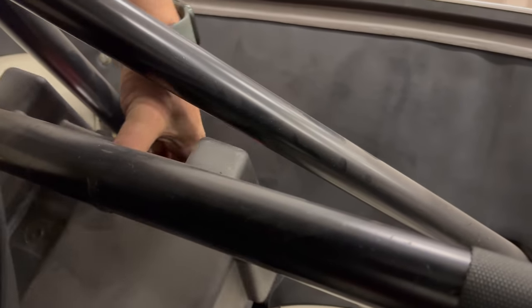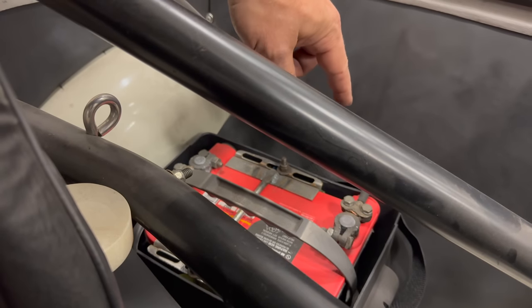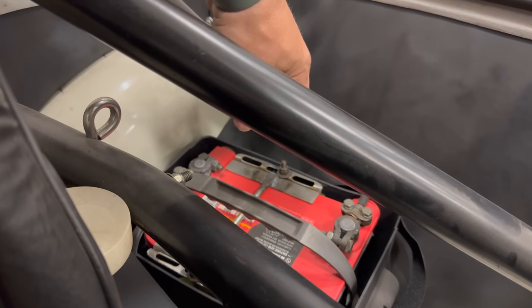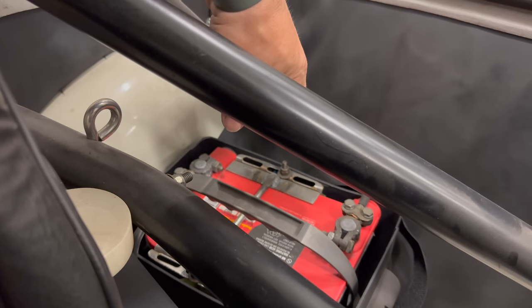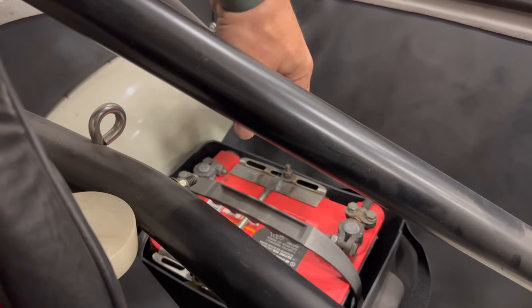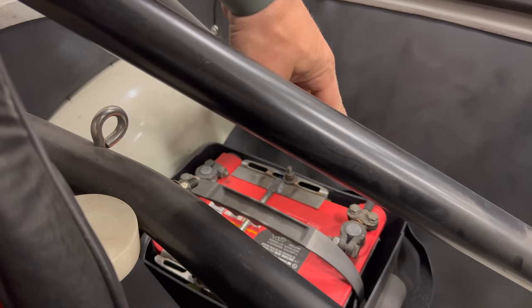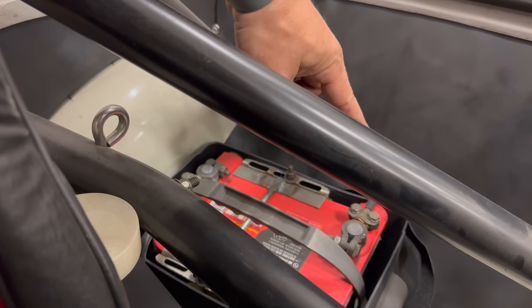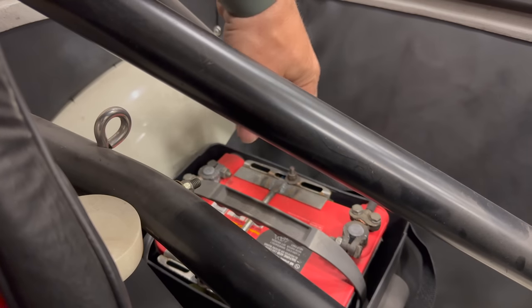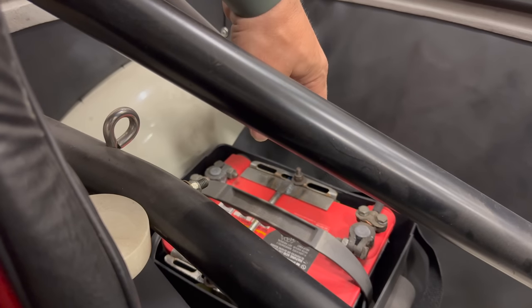You have to crawl in here around the jungle gym. There's a strap that holds this cover on. There's the Optima battery. I dislike batteries — I like to use ultra capacitors where I can. I can't decide if I want to put an ultra cap or a battery back in this car. The ultra cap would have the benefit that I'm not going to ruin it — you don't drive a race car all the time, so it is stored for long periods where the battery could drain and get ruined. But during a race, if the alternator were to quit, I might not have enough battery power to make it through the race. Whereas if I was running a battery, it's likely that if I turned off the electric fan and other things, I would be able to finish the race just on battery power alone. So I'll think about that for a little bit while I get this out.